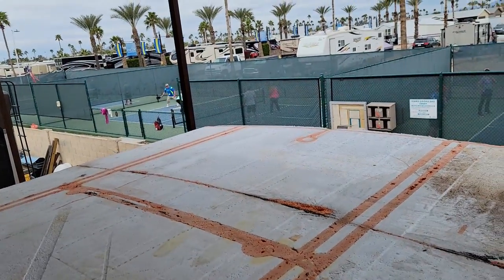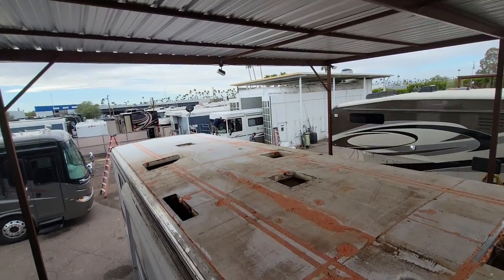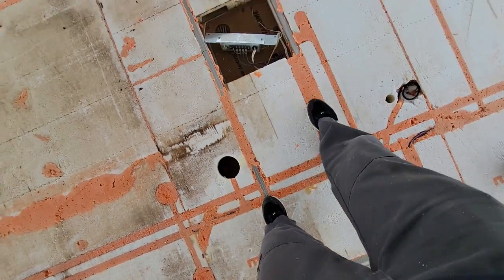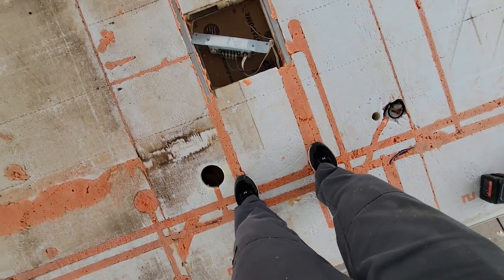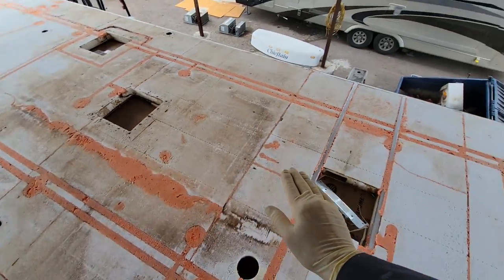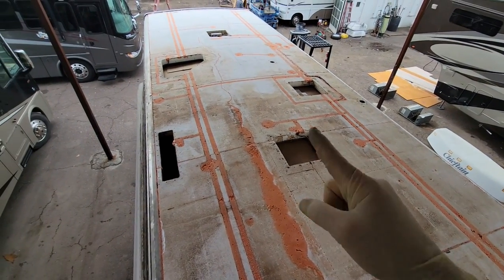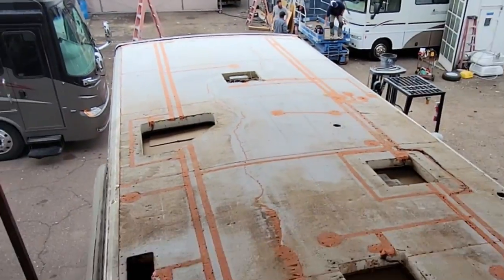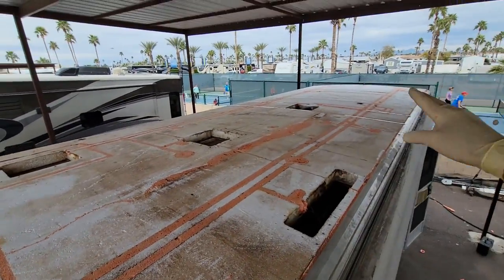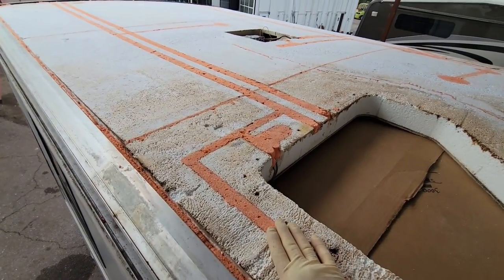All right, I think I got the roof done — or at least sculpted and stabilized — so we can laminate it now. I did manage to get those aluminum frames in the roof right there, so I can walk on right there pretty well. That'll handle the load of the AC. There's still a little bit of a low spot there — I'll try to fill as we laminate. There was a big crack the entire length of this AC duct right there; it's been stitched and glued back together, so it's all one big monolith as far as the styrofoam roof is concerned. All these orange channels where the wire runs were — this all becomes gluing surface too.